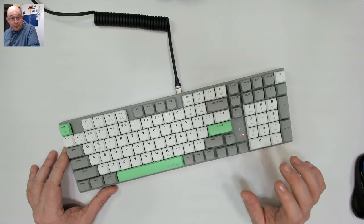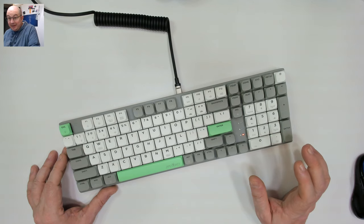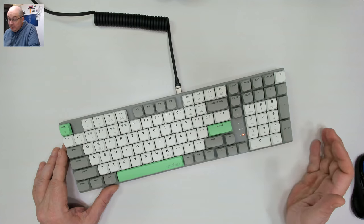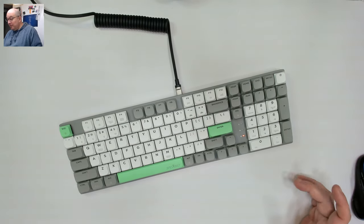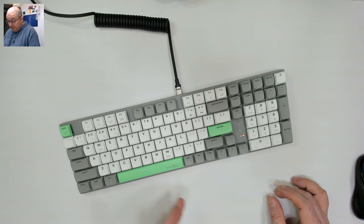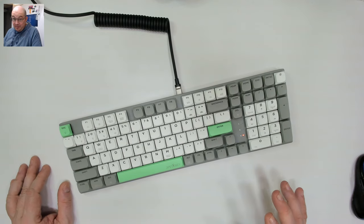Being able to take them apart and apply either a plumber's tape mod or the Band-Aid type mod would take care of a lot of that, but again, with non-hot swappable switches. Especially since all the other James Donkey keyboards I have previously reviewed have hot swap sockets, and plenty of other low profile keyboards have hot swap sockets.